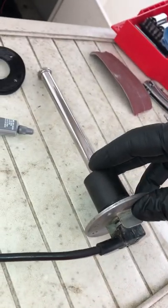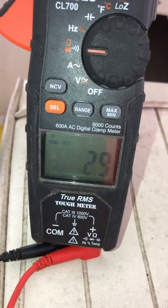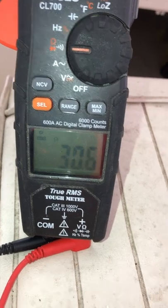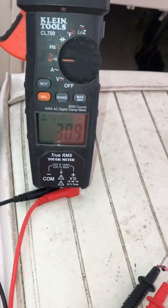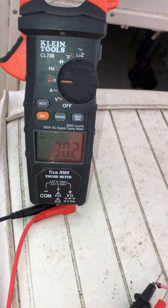Went all the way here, all the way full. It's supposed to read 30 ohms, just like that. Oh, I also recommend, if you don't have it, get some alligator clips so you don't have to twist it like me. This is all just a quick little throw together. It's supposed to be getting 30, okay? That's when it's full. Ooh, 33 actually, but I'm getting 30 and 31.